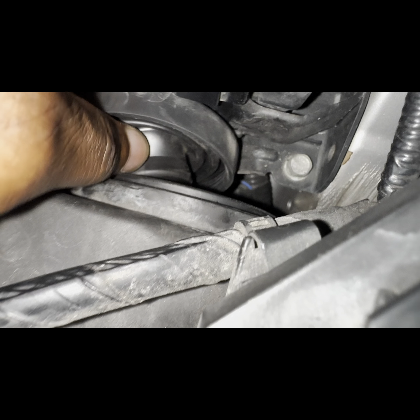You do the same thing on the other side — this side is actually easier because you have more space. Take off the prong right here, it's disconnected. Take off the boot. Move the door — that little hinge door. You can see the clip better on this side. You're going to push the clip in and up, it releases the door, and now the bulb falls right out. This bulb looks good, but I'm still going to change it. You can see that little black dot on top — that means it's about to go bad. Even though it's bright, it's about to go bad.